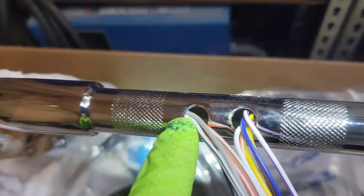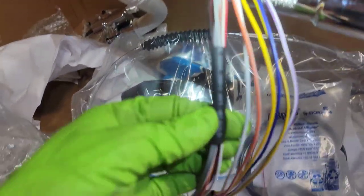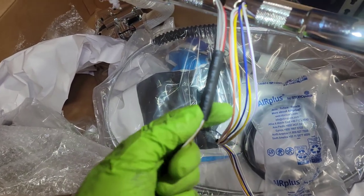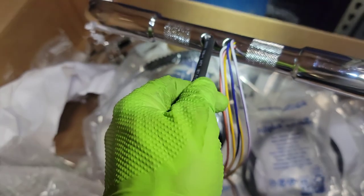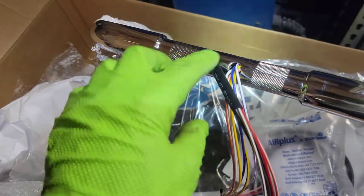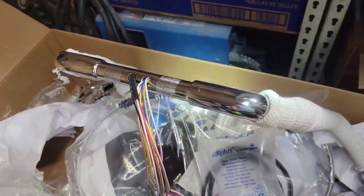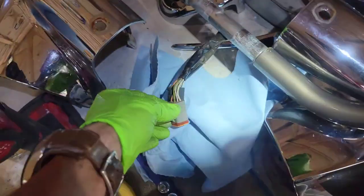Think of the vibration coming out of a Harley — what's that going to do to the edges of your wiring? You've got to find a little bit of slack. I'm sliding heat shrink into that hole so the vibration doesn't do funky stuff to turn signals, starter, or whatever it may be. We already got everything torn off the neck here. Old bars are laying here — we will need those plugs, so don't throw them away.